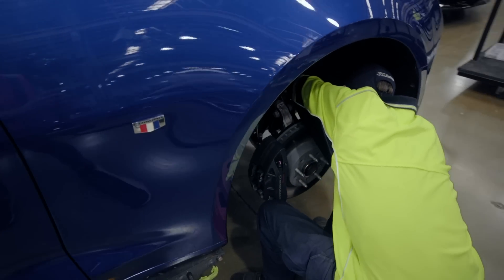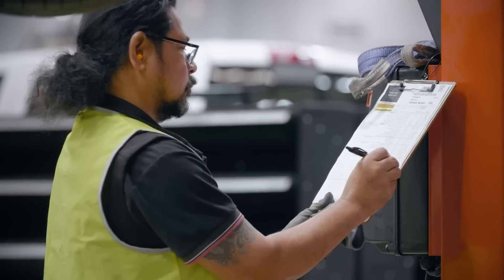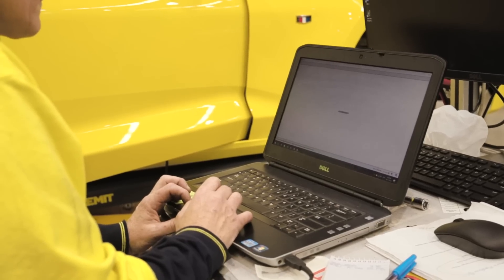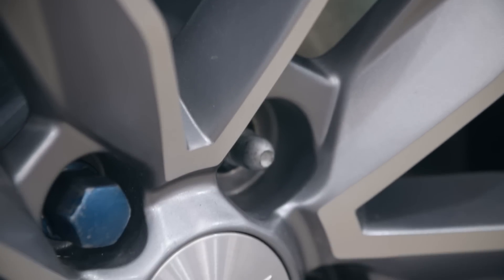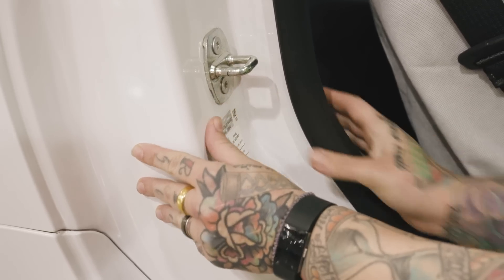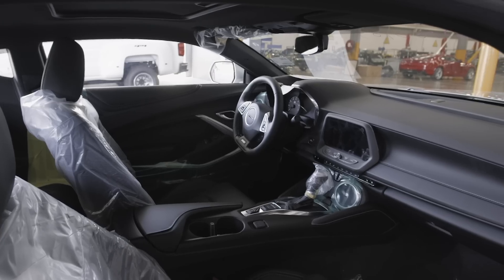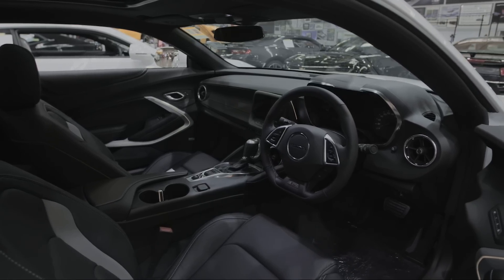Station 7 is a full inspection of the vehicle. They also do a recheck of trouble codes at that point. Then they take the car for a road test — we do about a two kilometre road test around the Clayton area. We just drive the car, operate all the functions, check the wheel alignment, check the brakes, check that the paddle shifts are working. If the car comes back from the road test with no issues, the car will go through the final station which is fitting of the compliance label and the build plate and some transport protection to the vehicle. I hope you've enjoyed your tour around the remanufacturing process of the Camaro.